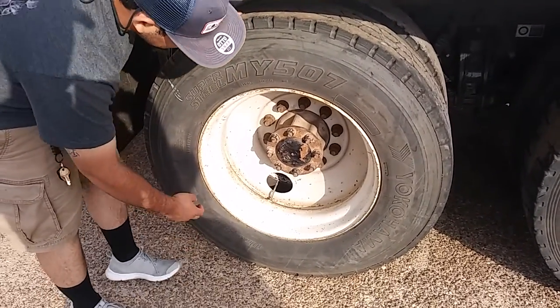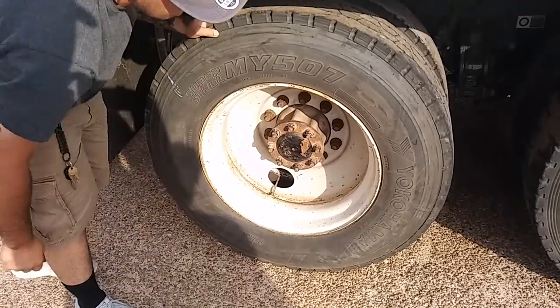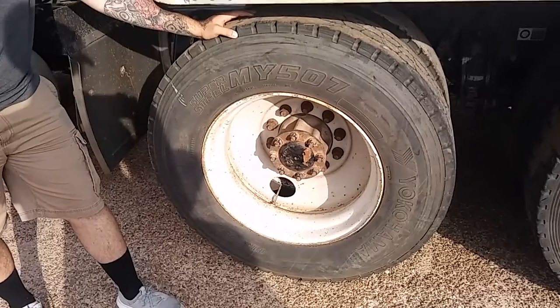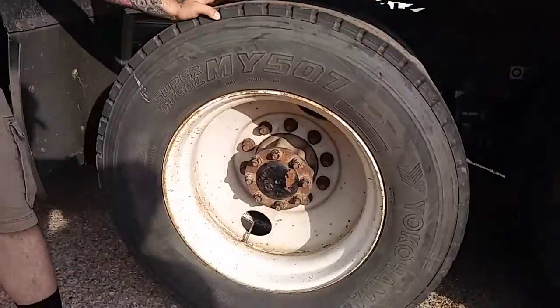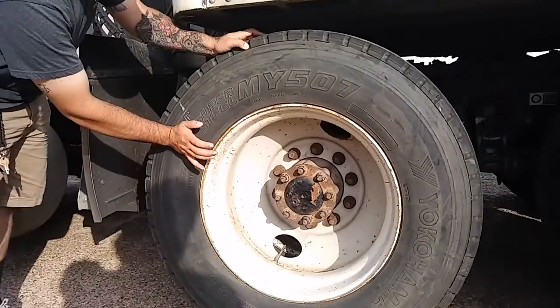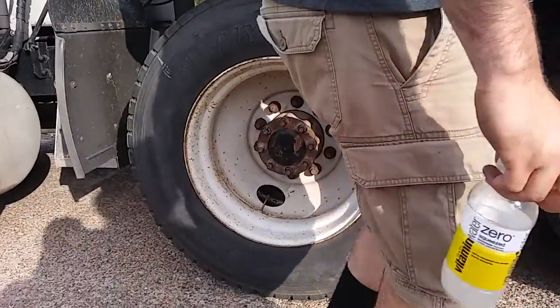It's not leaking. Checking both valve stems, outer and inner valve stems, properly mounted and secure. They're not cracked, bent, or broken. The caps are present and they're not leaking. These tires should hold 100 psi, manufacturer spec. I'll continue working down, starting between the tires.